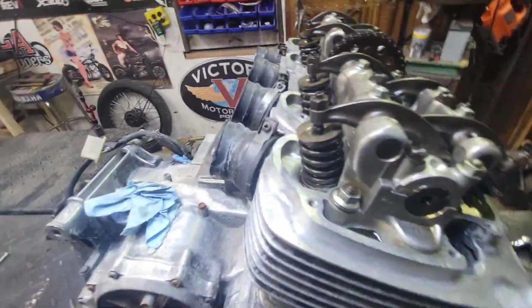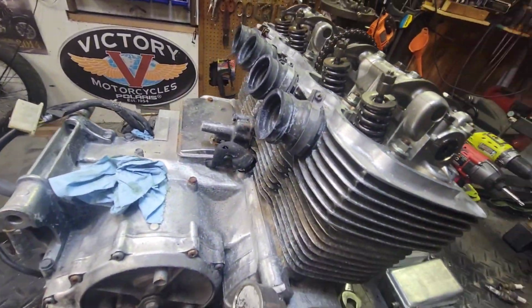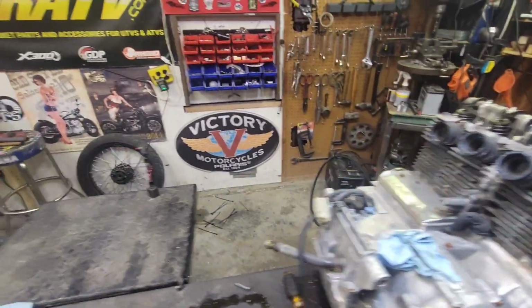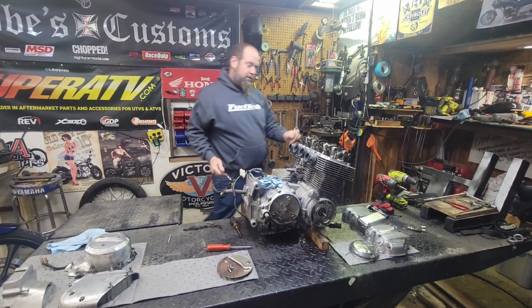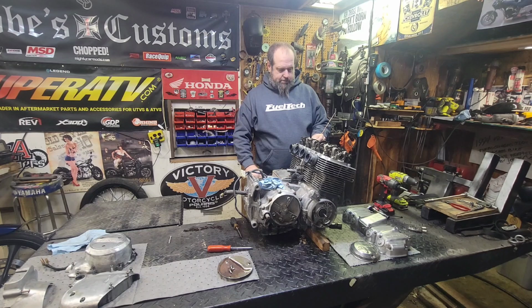I'm going to pull apart this tensioner over here, get her timed, at least get her at top dead center on number 1. Pull apart the tensioner, let's pull his head off, and see what we can get a look at these pistons, see what's going on. Is this right here? Piece of welding rod. Going down. Yep, they're coming up. Yep, going down.